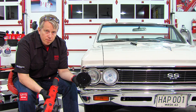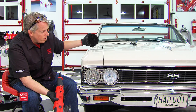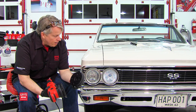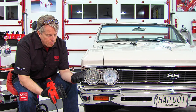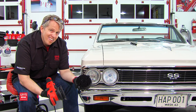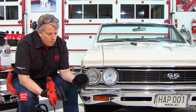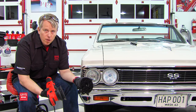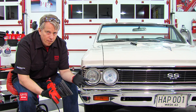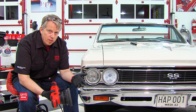Now let's look at the Boss Interflex pad. Take a look at this panel — a nice sweeping fender. If you choose to use the Boss pads alone, being thin, they'll have a little less ability to conform to curves. Throw the Interflex pad on and it will adapt to virtually any contour. One other thing the Interflex does — for lack of a better term — is it detunes your pad, essentially doubling your options by making the pad just a hair less aggressive. So if you're working with a soft finish and want to take it down a notch instead of switching to a finer liquid or finer pad, throw the Interflex in first and see where it takes you.